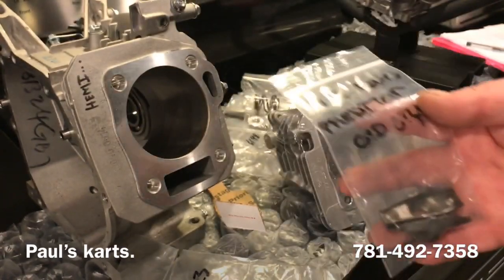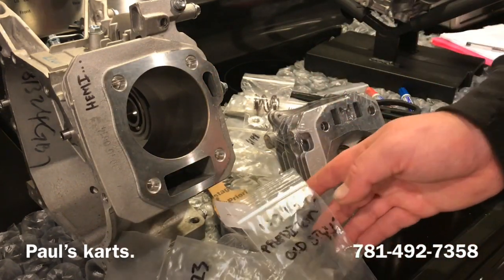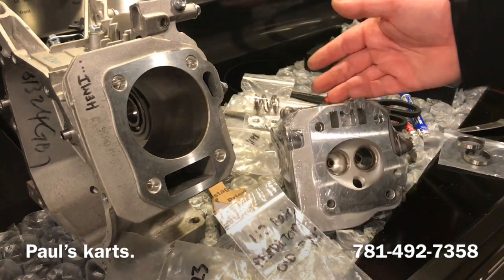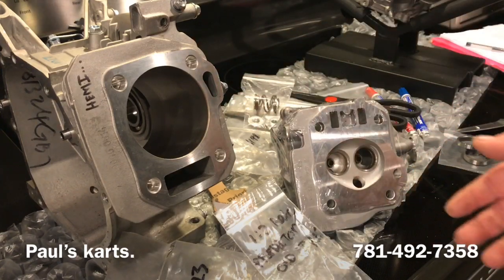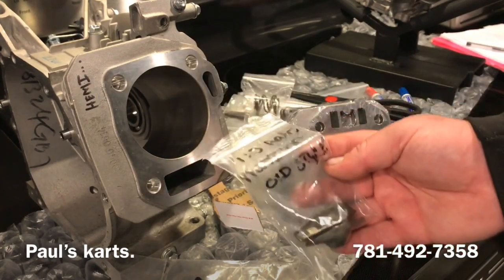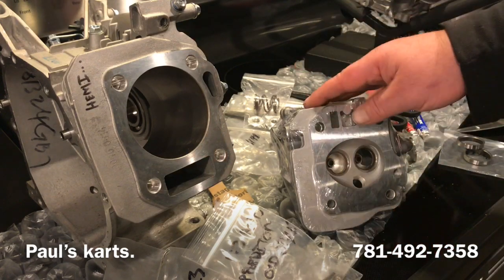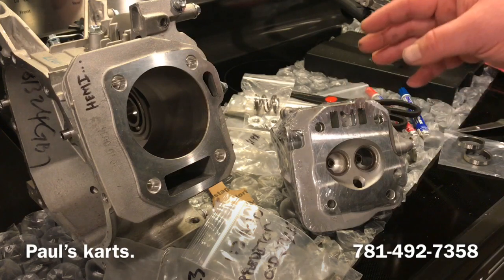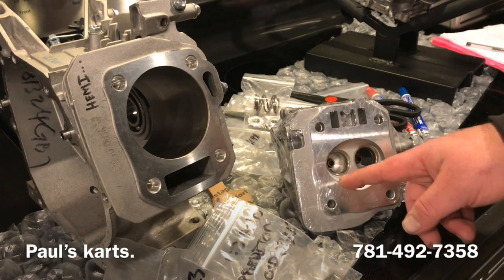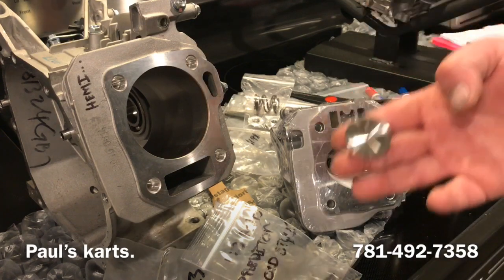These are relatively inexpensive. So basically, when you look at this build, what you're seeing is a cheap way of going about a build. Predator Hemi block, you have the big bore, the big stroke right out of the box. You take this 14cc cylinder head, put it on that block, you now have a high compression cylinder head. When you do the cylinder head, you get to go with some of the cheaper options like these 1.3 stamped steel rockers. What I'm doing to this head is porting stage 3, 5-angle valve job, bronze guides. I'm going to put the littlest bit of weld down here. His goal compression ratio is absolutely bananas, and we are going to be installing these larger valves.